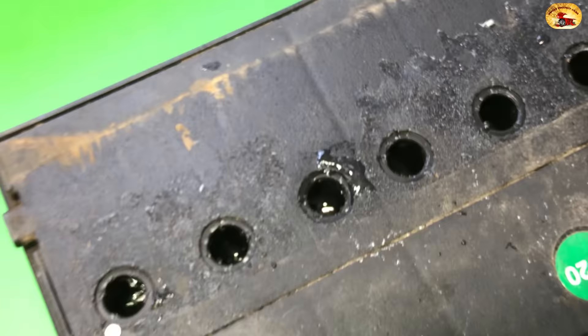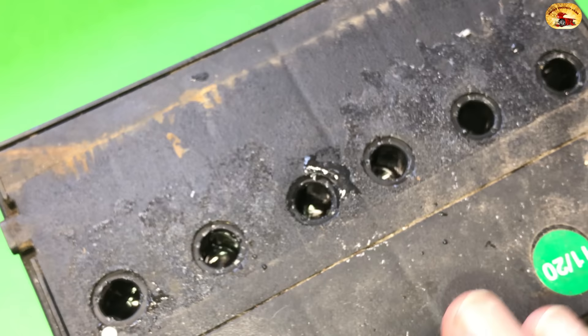I put my hand near it — the battery is not hot at all, but it's boiling good. Five minutes, ten minute rest, five minutes, ten minute rest, five minutes — three times total with the welder hooked up to it.